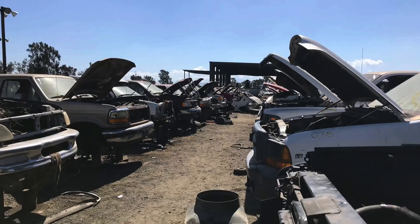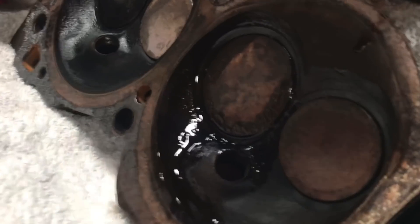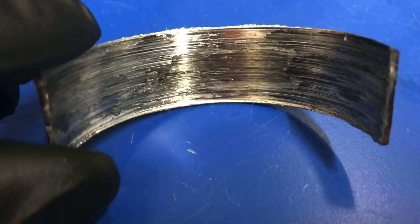So what I did instead, since we were ready to run, I ran over to the wrecking yard and grabbed a Series Three L32 — the upgraded version with the good blower — and ran that on the dyno. Unfortunately, those heads were also bad. As it turns out, the cylinder heads on these supercharged V6 motors have a problem: they tend to wear out either the valves or the valve seats, which we replaced many of them, thanks to the guys at L and R Automotive. We upgraded the L32 heads and got to run a lot of tests. Eventually I hurt that motor — we got some bad bearings or something, maybe because I didn't replace the oil.